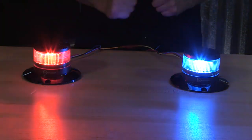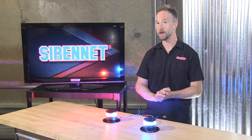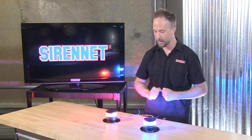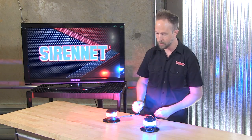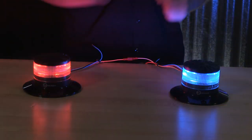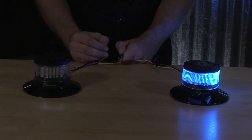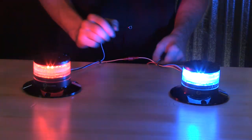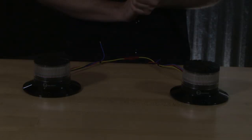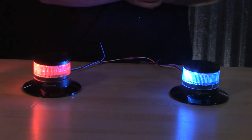Right now I have these synchronized with a yellow-to-yellow trigger wire connection, both powered and grounded behind the bench. If I want to make changes to the flash patterns, that is where the blue trigger wire comes into play. It's not switchable by positive 12 volts, but the reverse of that — a ground source. So that's kind of what we've come accustomed to from Code 3. I'm going to change both of them simultaneously using blue to ground, and that combined connection actually did a simultaneous changeover.